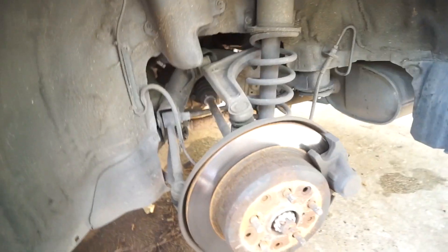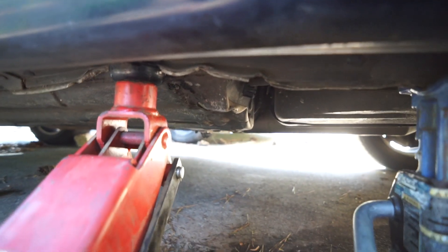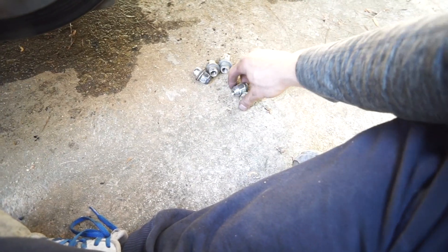Wheels are off. The correct way to lift the rear of the car is to lift it by the differential, but there are no real jacking points on this car. There's the standard crease but you can see it's been mangled already by somebody, and I contributed to that just now by trying to jack it up via the crease. Doing this one side at a time might be safer. Looking at the lug nuts, two of them are the same but one is different — almost seems like a lock nut — and then these are acorn style, which are not the correct style for this wheel.